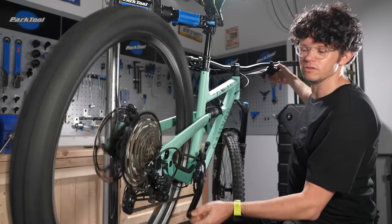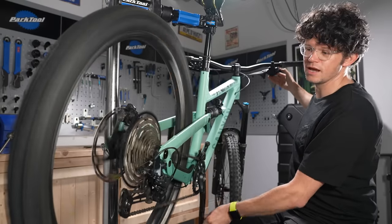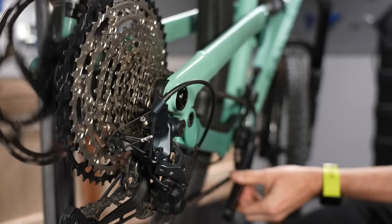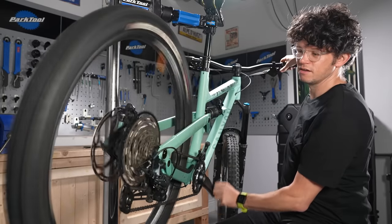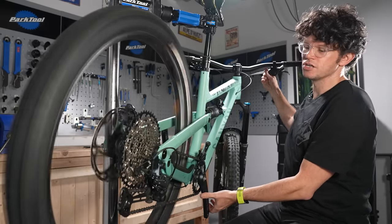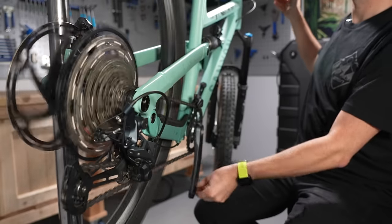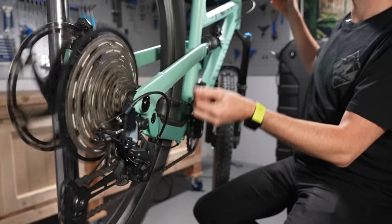Now we should have the tension at the right position — click up, click down, click up, click down. If your rear mech is making noises after a shift, it often means there's not enough tension. So we're going to turn the barrel adjuster anti-clockwise to increase tension, and then shift back and forth again. Once we've got that shifting from cog one to cog two sorted, it's a good idea to check the rest of the sprockets and how they're shifting too.